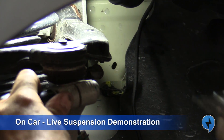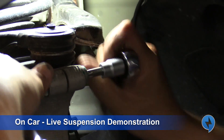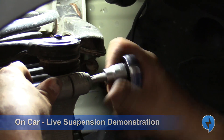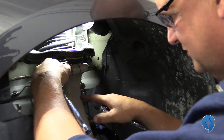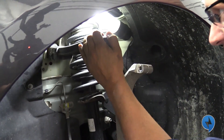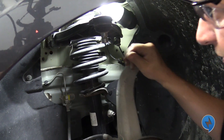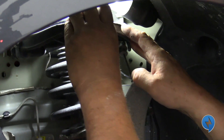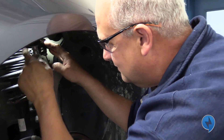So what we're going to do is remove the upper control arm from the front spindle here. You'll notice that a lot of the Teslas, they mark all the bolts with paint marker. Now, there are two revisions of these control arms, which we'll be talking about. This is a 2018 Model 3, and what they do is they get squeaking in the bushing because they get dry.